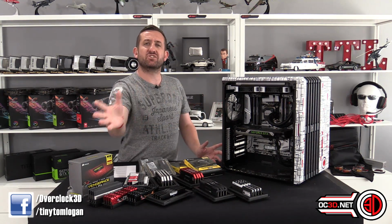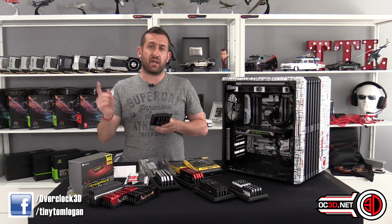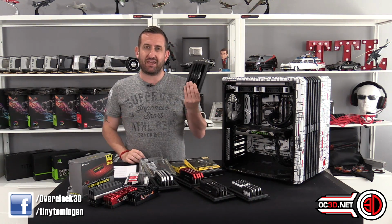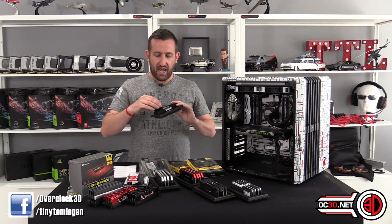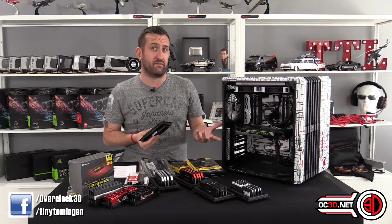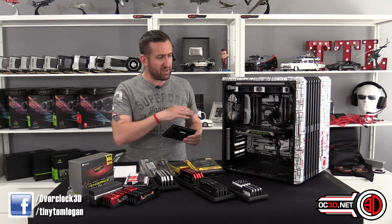So when I do a stock test, just to let you know, all I do with stock is I chuck a 2800 megahertz LPX kit in, and then I go into the BIOS, I enable XMP and I leave it, and I do that with all of the boards, and that's our stock runs. You may think 2800 megahertz is quite high, but for a stock run, there's no reason why you wouldn't want a 2800 megahertz kit, and I personally don't think a 2400 megahertz kit is much of a step forward with DDR4, because we could have easily done that with DDR3. So we go 2800 megahertz because it means it's having to stretch its legs a little bit. So we do that, we do our stock runs.